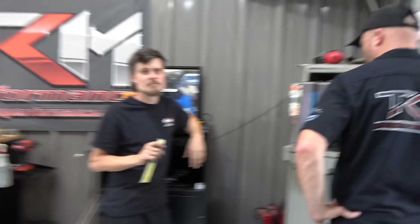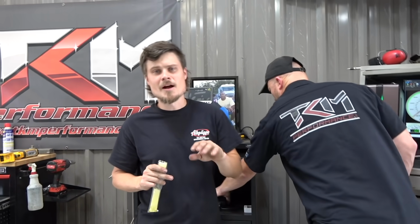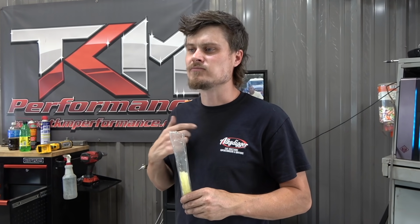Not the happiest ever. Something is going on where there's J2B, up to J3, and then J4. So J3A was the one you were using? J3 is done, no power. J2B is done, no power output. It'll output ground, but it won't output power. So the air shifter, boost solenoids, some stuff wasn't working. Holley can output a ground, so 10 of the pins are ground output, PWM negative, and 10 of the pins are PWM positive. All the PWM positive on that connector are done. So you switched them to some other connectors, all to the J3, which I wired yesterday with the trans.